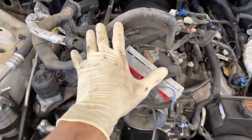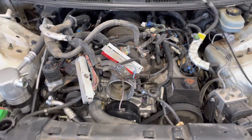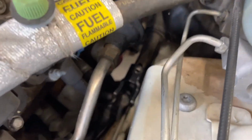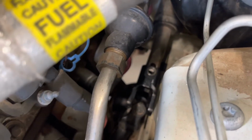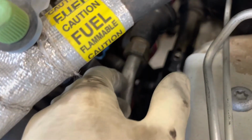Here you can see I've laid the harness on top of the motor, getting ready to drop it out from underneath the body. One other thing I would like to mention is your steering shaft here. It's not focusing very well, but it is really hard to slide it apart, and it's easier as you lower the K-member from underneath the body to watch that and slowly help it along as you slowly lower the K-member till that breaks loose.